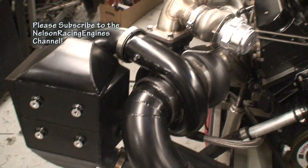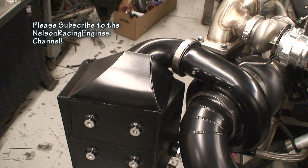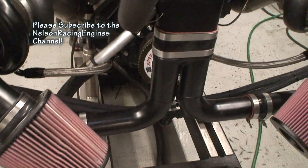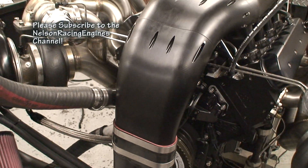Going into our turbo, we've done a real tight air inlet to fit it in the car. It blows right into the top of the intercooler, which is cooled through water. It travels into our new anteater snout, which has got a 5-inch oval for the high horsepower applications.